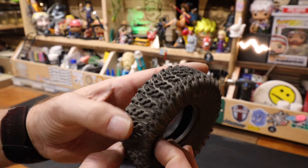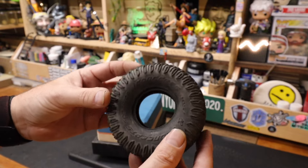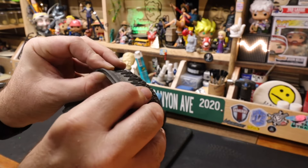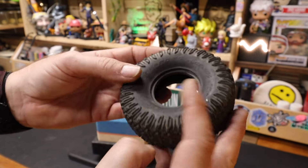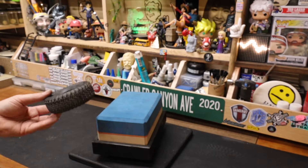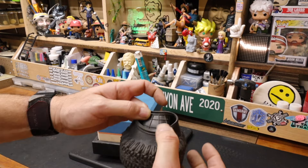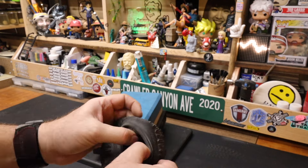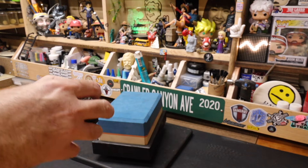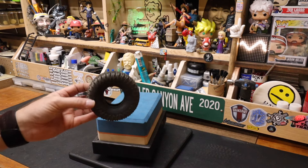They've been run in both directions to the point where they're pretty worn. This is where J-Concepts go first — right along that bead ring — but they look pretty good. One of the first sets of J-Concepts tires we ever bought, because during that time the Tusk was perpetually out of stock. They are not belted nor ribbed — they're webbed, and the webbing continues the entire inner part of it, for strengthening. It is a carcass of typical thickness, around 2 millimeters thick.